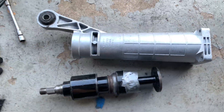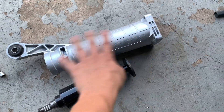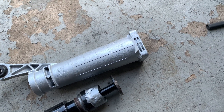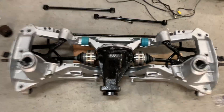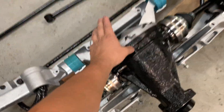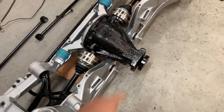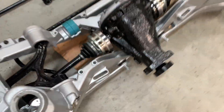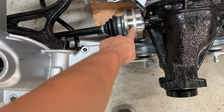We just need to get this balanced and throw it back together — torque it up to about 105 pound-feet. Then we can bolt this up to the rear diff. I already did a video on the whole assembly of the rear diff. I finalized it, put the rear cover on, torqued all the caps, got everything finalized, torqued the nut — I was just waiting on a new nut, a new seal, and new side seals. I threw in the axles and finished those up too.